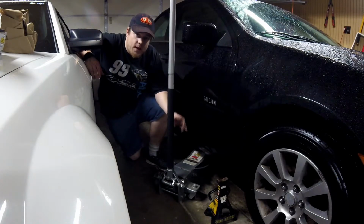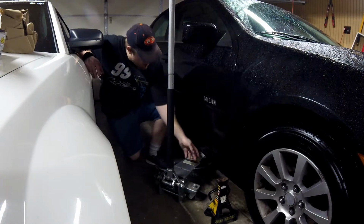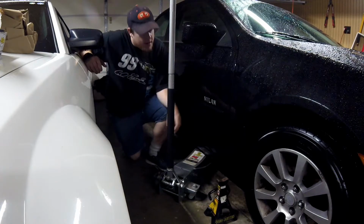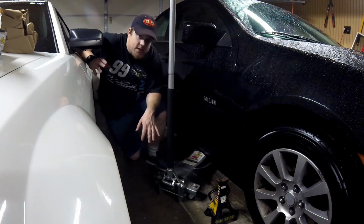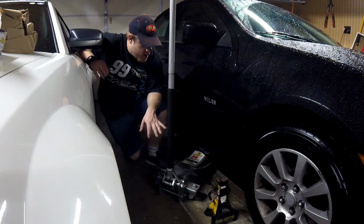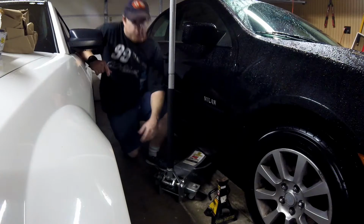Everybody, a lot of people, wonders about the safe place to jack up your car. There's something called a pinch weld down here at the bottom, and it's where the body panels are pinched together and welded. It's actually a very strong spot. That's where I place my jack stands. That's where I jack up the car. Don't need to get the car super high, we're just doing brakes.